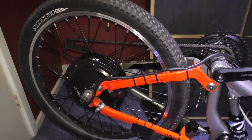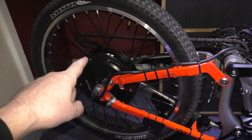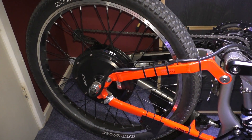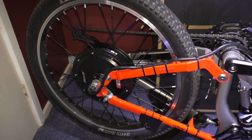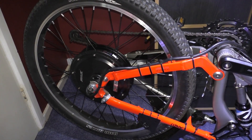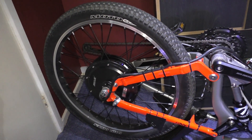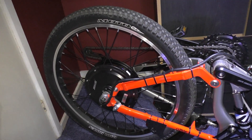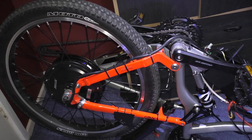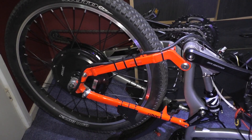What it's doing now is - because in the motor itself there are hall sensors, from what I can gather, to detect the three phases - it's very slowly going around and just checking to see where the sensors are. And then it will automatically give you the hall angle. Fingers crossed. It looks like it's detecting it. Test OK. So it's come up here and it says 245 degrees. It's done it.